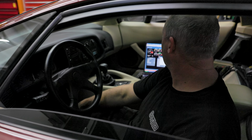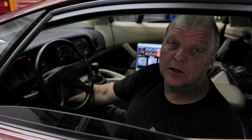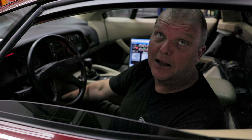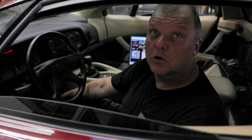At this point, it definitely seems to run pretty good. It has not yet been tuned at all. So basically, you saw when I first tried to get it to start and it didn't seem to want to start, I literally just changed the entire fuel map by about 20% and then it seemed to start. It seems like the actual map at this point is probably still a fair bit rich.